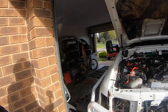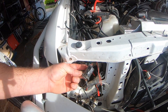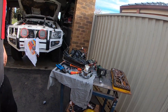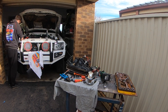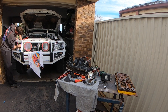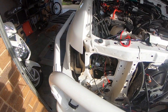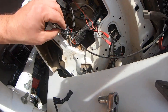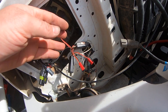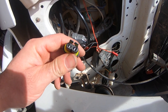Now we're going to remove the module, which is this part. This drives pretty much most of it, and then it plugs into your headlight loom. Got the new control module in. There's the headlights — it plugs into your headlight there. There's your LEDs for the front. That is for the pop-down solenoid that comes in it, and that goes onto your ballast. It plugs into your ballast, and then your ballast plugs into your headlight.